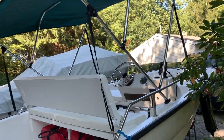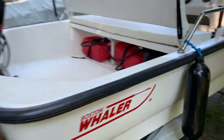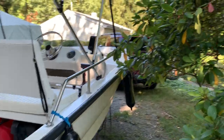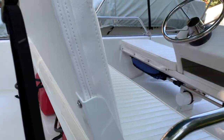This boat also has a bimini. It has a lot of features for a 13-foot boat — very clean hull and nice logos. One thing I like about this generation from 2000 to about 2008 is that they have three through-hull fittings. One is in the anchor locker up front, one is here in the rear — as you're underway, you can pull that out to drain water and stuff it back in once you slow up. The third, for when you're moored, you pull this one out. The boat is set up so that when it's floating level with nobody on it, all the water drains to this location. You can leave this plug out when leaving the boat unattended, so you don't have to worry about rain or a big wave filling up your boat — water will bubble in and out, but most of it is going to leave.